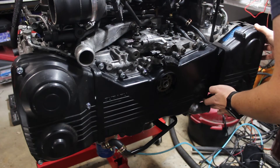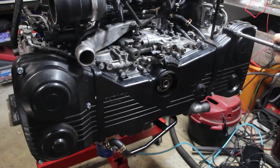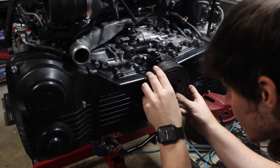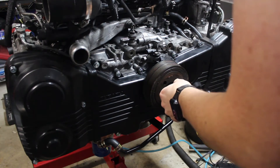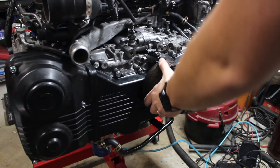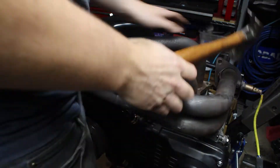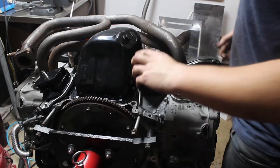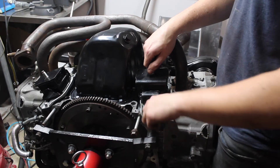With the intake on, I attach the timing belt cover followed by the crank pulley. The manual calls out a torque angle for the crank pulley bolt, which I was able to achieve with my pneumatic impact. Then I flipped the engine over and installed the header. I spent a while cleaning it up, and while it isn't polished, it isn't rusty anymore. It did take some persuasion to get it on. Then I installed the engine mounts — these are STI engine mounts, which were actually cheaper than the original ones.